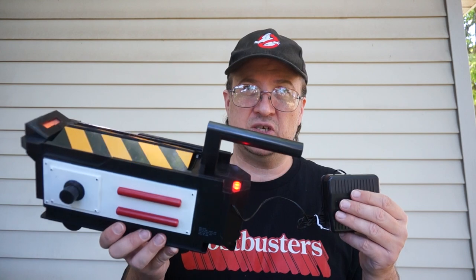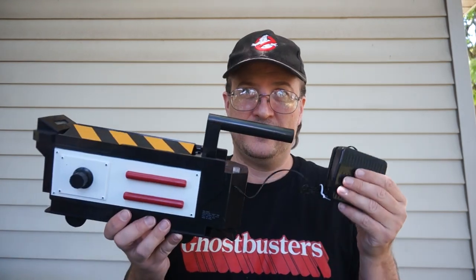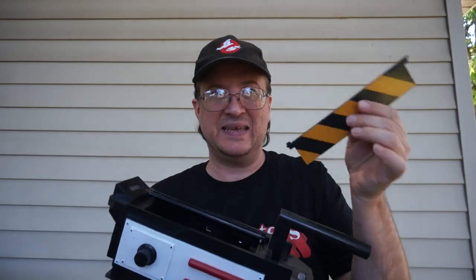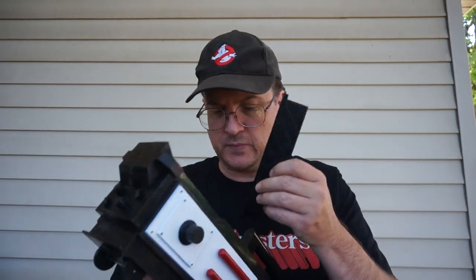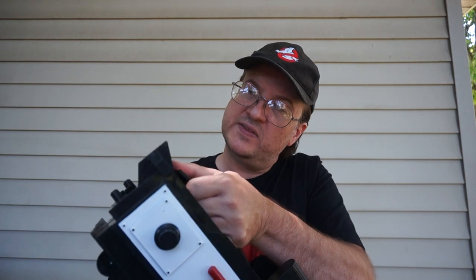Let's go to the on position. You want to park it right in the center there. Now, the other problem you can see with this one is that the doors are not shutting completely, and it's a very, very simple fix — they just pop out. You want to bow them slightly in the center. Remove them. Bow and remove. You see these white gears down here? That's what the problem is. You just have to get these black teeth on the back side of the trap door to align into those teeth so that it sits flush when it's in the shut position.